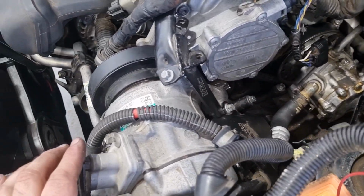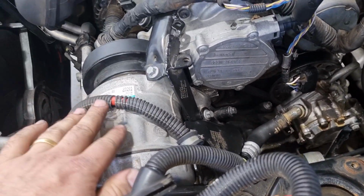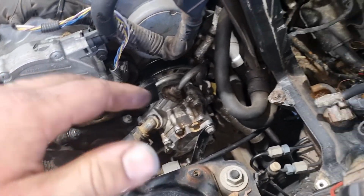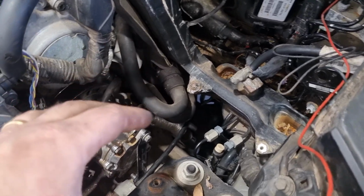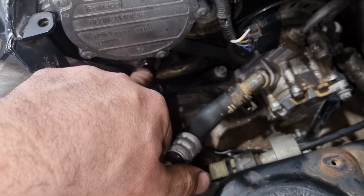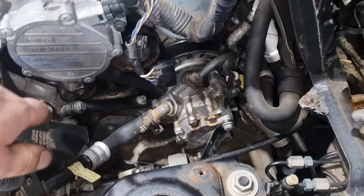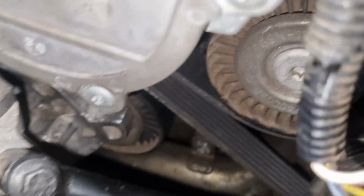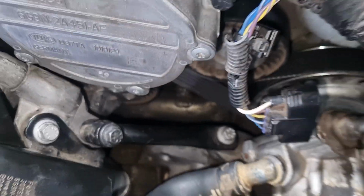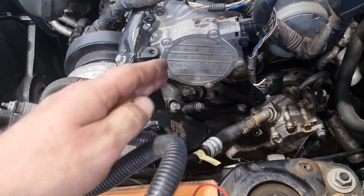So we just changed this belt, and it's taken a good few hours. Just a couple of things. First up, you need to take the compressor off. We're in Australia, so we had the battery here, so we'd pull the battery out. In the tensioner down here, you need to load the tensioner up a bit more and put a little Allen key in that hole to hold the tension on the tensioner.